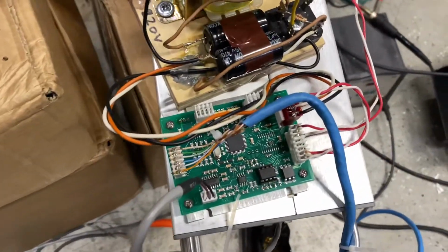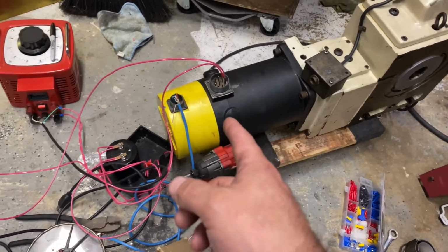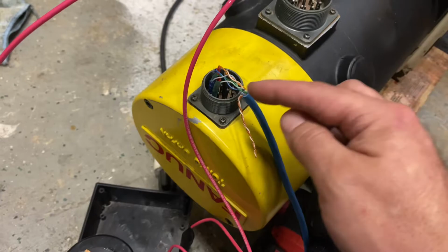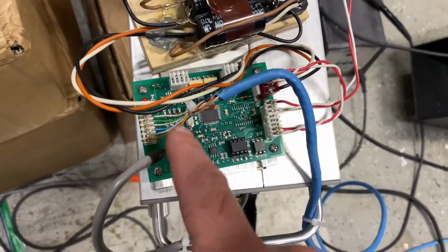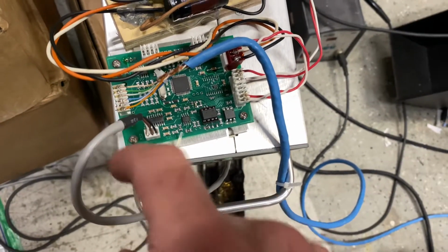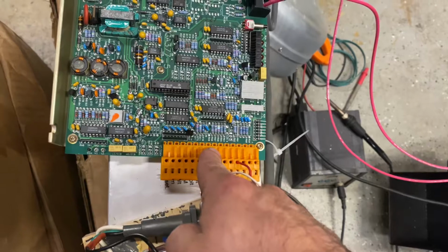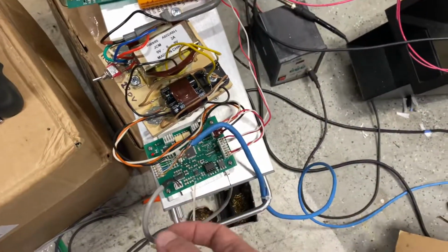And over here, we have the same thing, but instead of wiring an ECU, it's controlling this big DC motor. So a DC motor only takes positive, negative, right? And then this backside is the encoder, which has an A, B, and they're differential, so it's A and minus A, and then B and minus B, and then plus 5 volts and ground. And we feed that into this controller here. So these come in here. I think it goes power, ground, A, and then B channel. And then we have our output right here, and these go all the way down into here. And that's the signal input, and the other one's the common. And that'll drive the motor while getting feedback from the encoder from here.